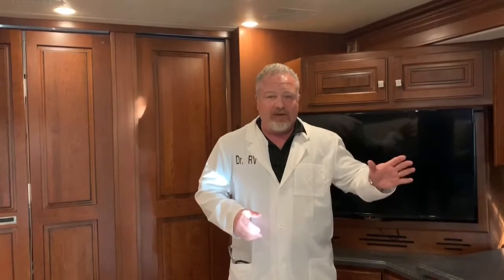You ask the doctor: I'm out of power completely. I don't have AC, nothing's on. A good indicator is the microwave — check if you've got any power coming in at all. If the microwave is off, you're not getting any power. If it's blinking and the lights are on, you've got power — you just may have an AC problem or another component problem.